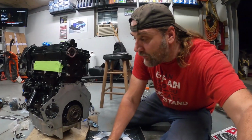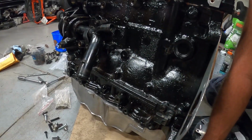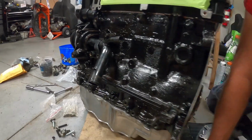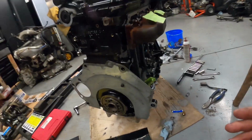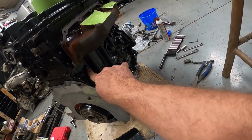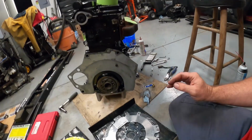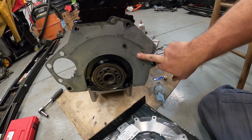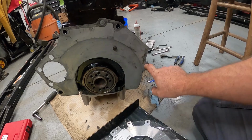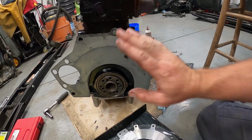All right, seems to be a pretty long night here. A little dark out. We got the coolant pipe in. I still need to find one bolt for that. Everything else so far is good. I got some of these fittings here figured out. I'm going to reseal this one here yet. And everything's blocked off. Yeah, and the manifold's on. And I got one of these all nice and cleaned up. I still need to pull one of these alignment dowels off of another block because it was missing out of this one. Then I can get everything tightened up.